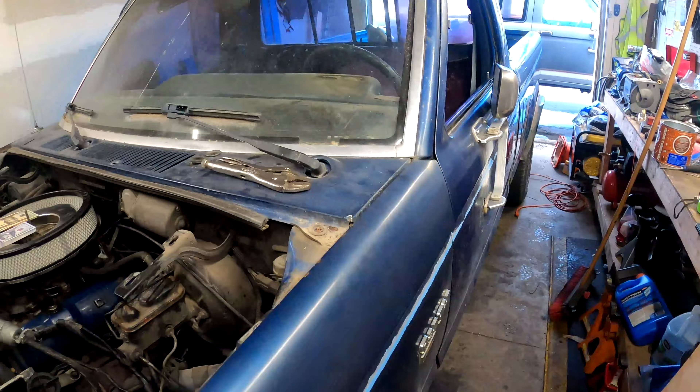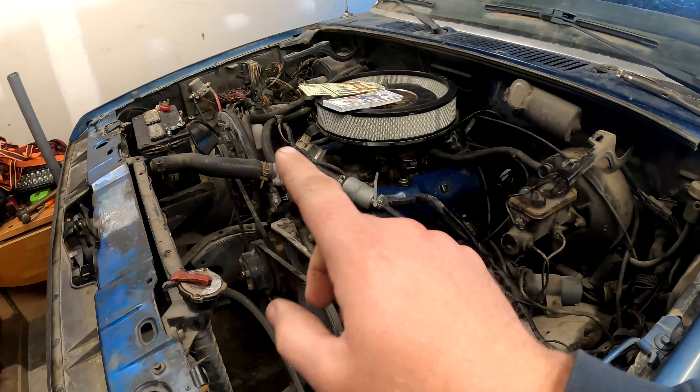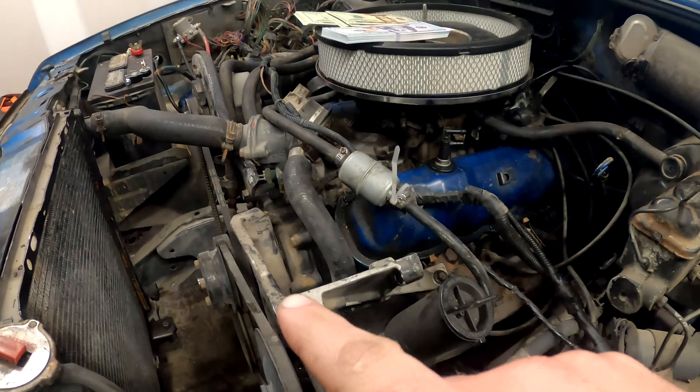It's been kind of hectic last week. With this guy, the blue sled, we still have to rearrange the motor and figure out what's going on with it. I gotta pull the whole front end of this thing apart because in the last video we were messing around with timing. I pulled the number off the block — this is not a 2.8 block like the original owner told us. It is a 2.9. Researching it, this is an old Mustang 80s/90s-style conversion kit — converted over to carbureted with a Mustang ignition module.